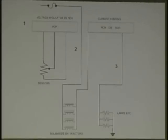Especially Chrysler products, one of the sensors might short out and take down the 5-volt bus. Now, when it shorts out, does it blow out the computer? Not necessarily. It's made so that if it gets shorted, that 5-volt reference has current sensing and it'll drop out. It'll go down, but it may not necessarily go bad. Therefore, if you disconnect the short, you'll get it back to life.